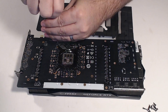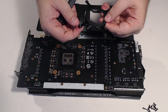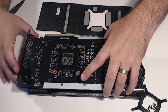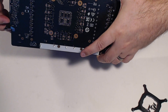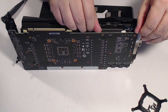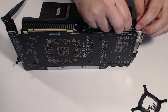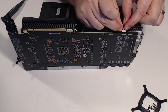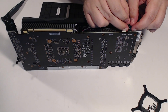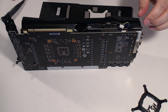Let's go ahead and remove the GPU mounting bracket. These things are spring loaded — they put quite a bit of pressure on because you don't want a loose connection, you really want it to be secure. Getting this part separated, it's still just kind of thermal paste holding it together at this point, but figuring out how to pry it apart does take a little bit of doing. You can see there are two connectors for the three fans — the white one powers two of the fans and the black one powers the third. I'm not sure which fans exactly the white ones go to. Let's disconnect these and then we should be good to actually pull the thing apart.